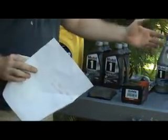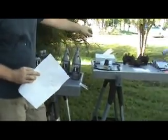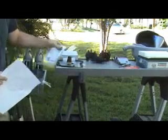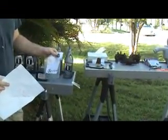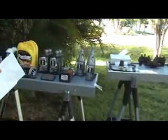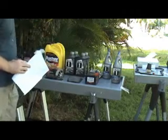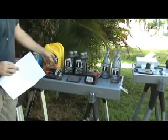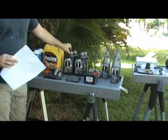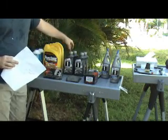So while we're digging around, we figured we'd also do the front and rear differentials. So Gigi went to the dealership and picked up some new drain plug gaskets for the differentials, and we're going to use Mobil 1 synthetic for that. Here's the fluid for the transfer case. So we're going to replace the fluid in the transfer case as well. Drain it out. I'm sure it's never been done.